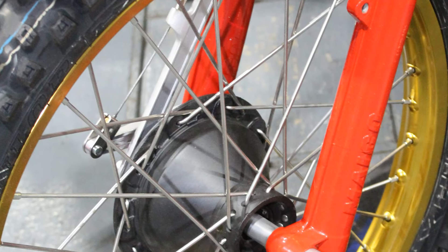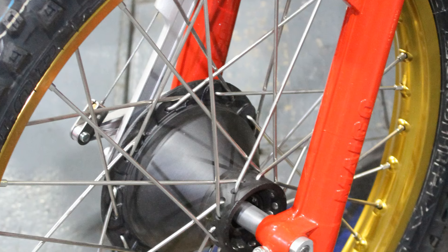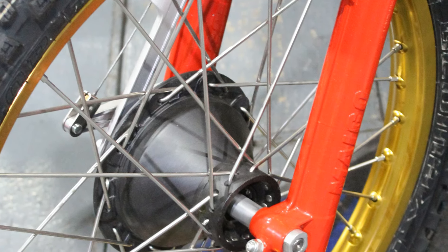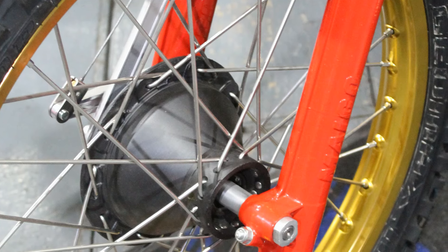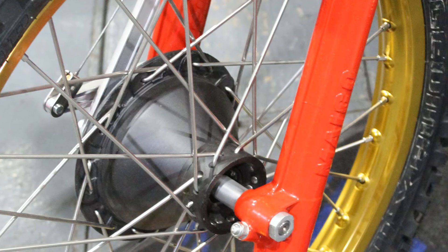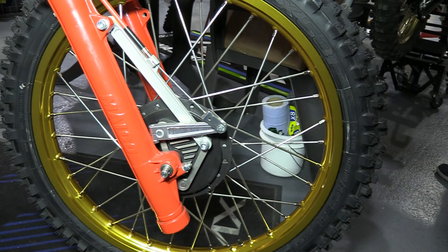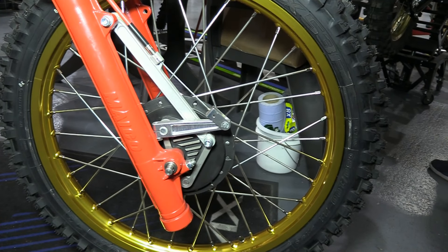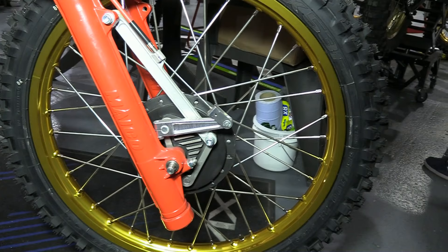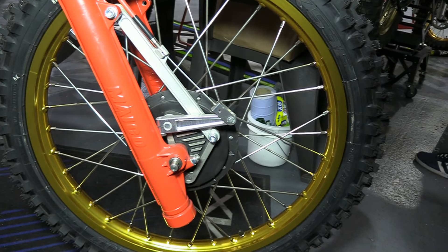At the front end of the bike you can see that these magnesium hubs — not the standard alloy ones — have had their ribs or cooling fins removed just to give them a little more of a factory-type look. On the brake backplate side, the stock alloy parts have been Cerakoted in satin black with raised highlights in plain alloy, just to add another dimension to our '79 400.